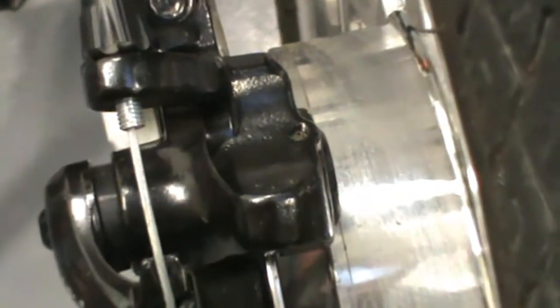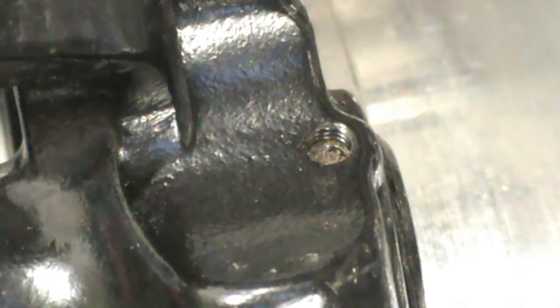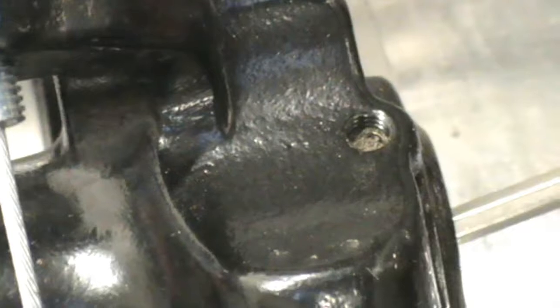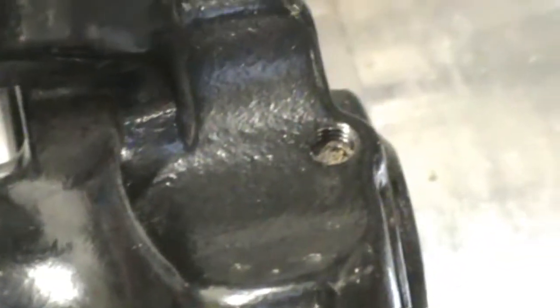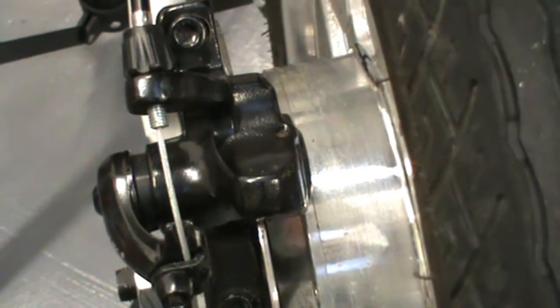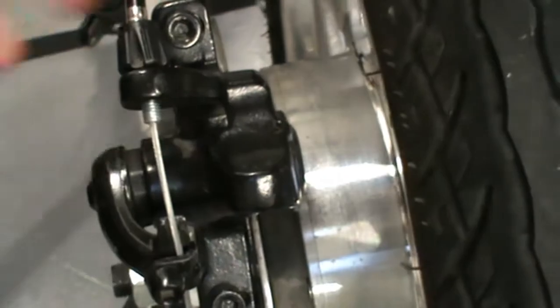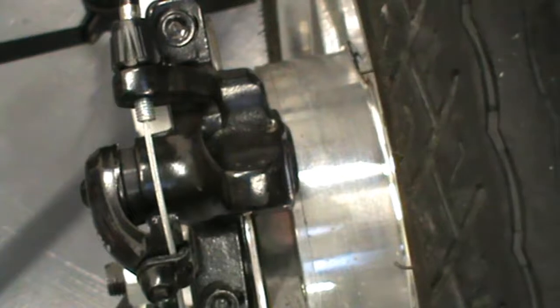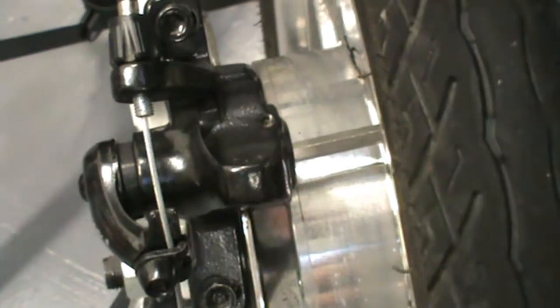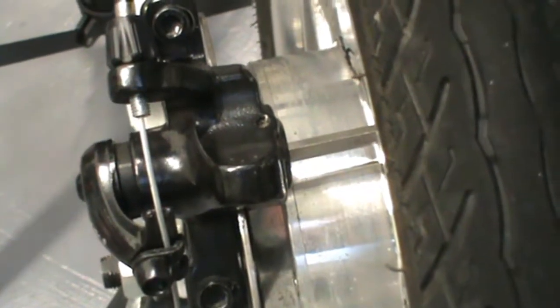Looking down from the top of the caliper, there's the grub screw in there — you can even see the dust in it. That there is the adjuster, and my 5mm allen key will be going into the face of this part. First, open the grub screw. Get the right size allen key — it'll be very easy to round it off. They're not under much tension; they just make sure the brake pad can't start creeping while you're riding. Now, if I turn the allen key clockwise, I'll move the brake pad closer to the rotor.